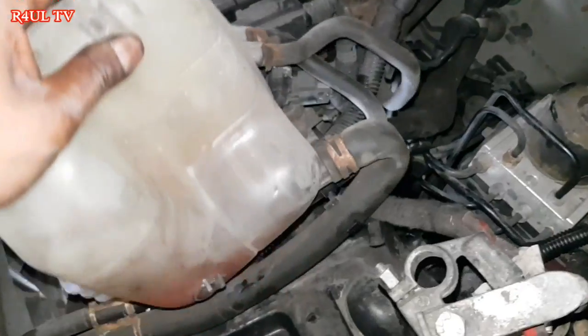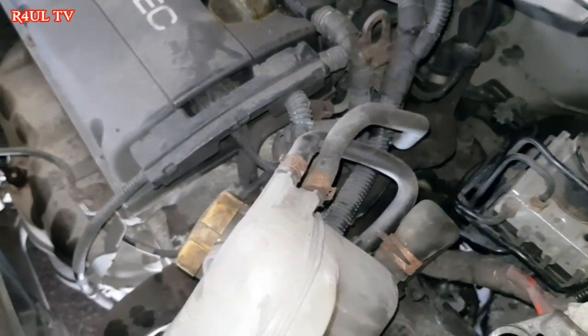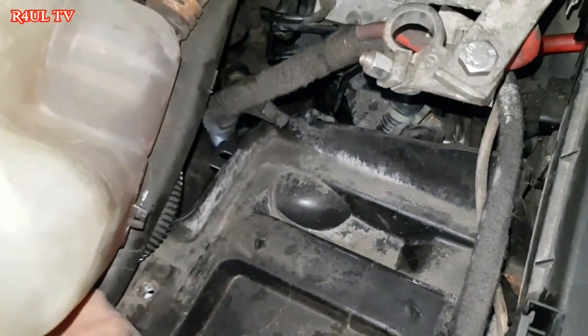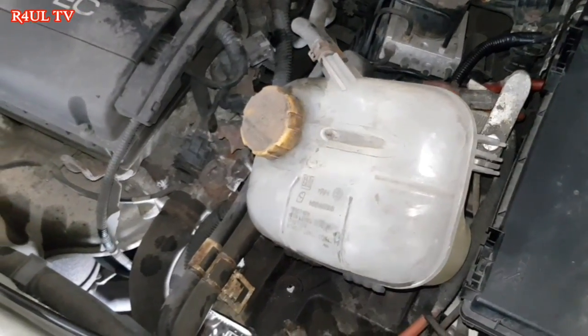Okay guys, as you can see, I've fitted everything on. The gear linkages are back on, right down there. All the bell housing bolts are on, the slave cylinder pipe is on, bled through. What I'm going to do now is put the battery tray back on, 3 bolts, remember. But before you do that, fit the expansion bottle, it slides in, and that way the top is done. We'll send it up, finish the bottom off.